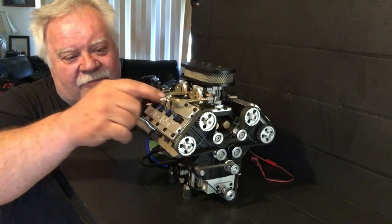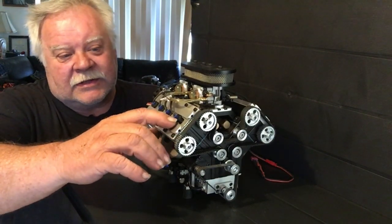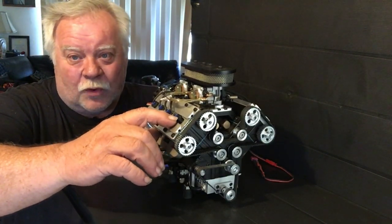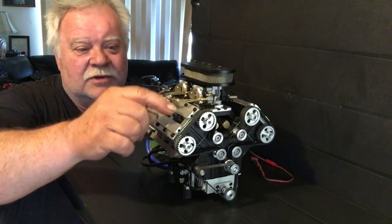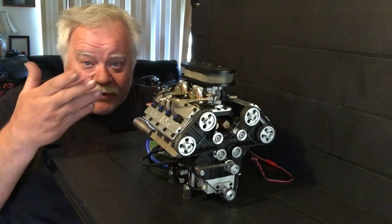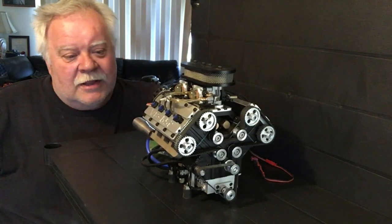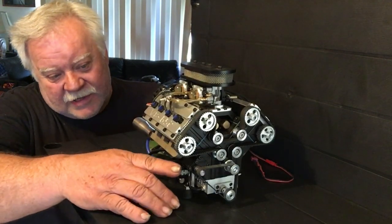As the oil rolls down the chutes, there are actually holes in the head for blow-by to keep the engine pressure down. And when you look at the little oil cap here — there's one on each valve cover — they have a little vent in there to keep the internal pressures from getting too large.